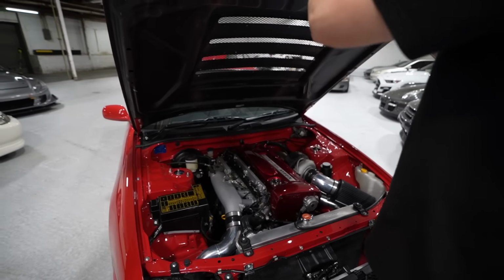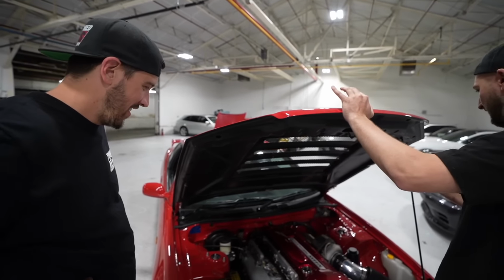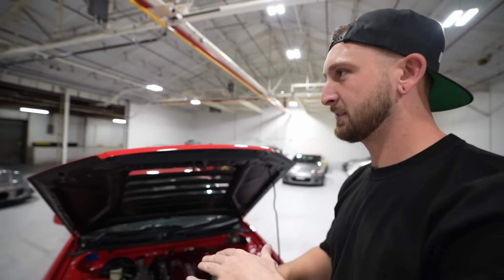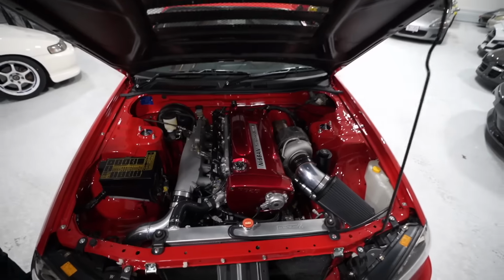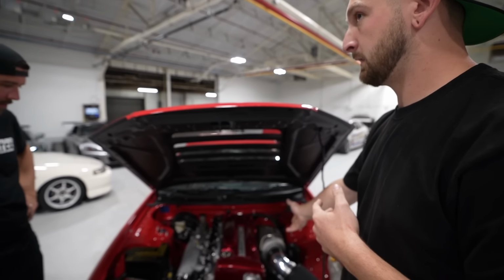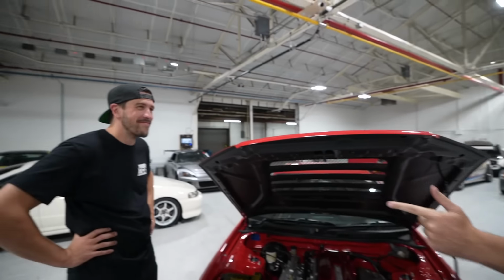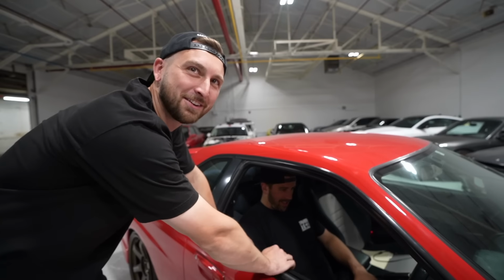Look at this. I've been wanting to see this thing. RB31. Hell yeah. Straight from the islands of Australia. I like the big bores. No, actually, I have no idea where this bottom end came from, but somewhere down in the southern hemisphere. RB26 head, I'm pretty sure it's a 32 head. It's just a simple piston, rod, top end package, stock intake. G30 770. It's small, but it hits really nice. It's really good. Simple. It's on a link too. My favorite. Hell yeah.